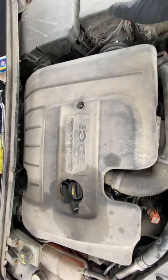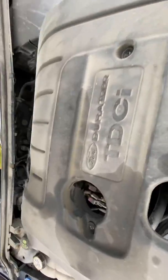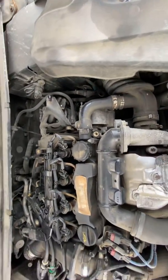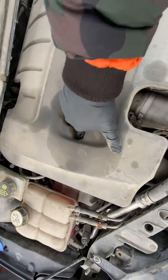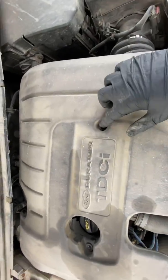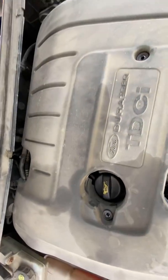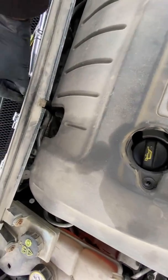If it's reading completely erratically — so it's reading 200 degrees one moment, then minus 10 the next — your engine will run like crap. This cover comes off with two 10mm bolts; a spanner won't get in there, you're going to have to use an actual socket. Take off those two screws — very easy, takes about two seconds.